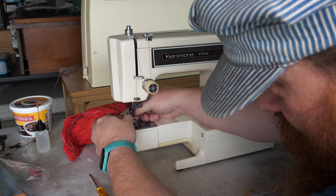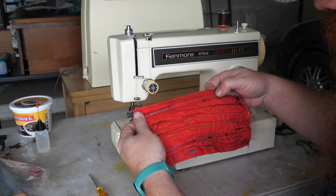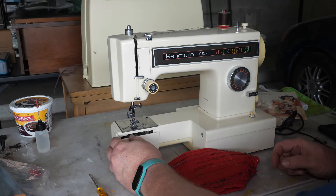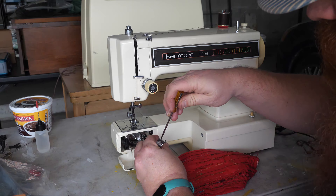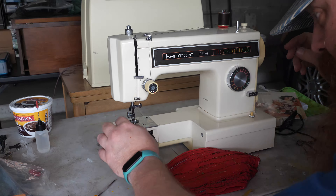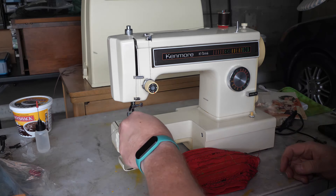Let's try a big zigzag. The reverse is working. The straight stitch was pulling the bobbin thread up a little because I've got it set for six tension, but under zigzag it was not pulling the bobbin tension far enough — the bobbin tension is too high for zigzag right now. I'm going to pop this open. It was so loose I did adjust it by about a half turn to get started, so we'll loosen that up by an eighth or a quarter turn.